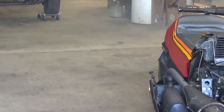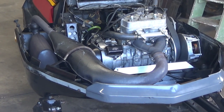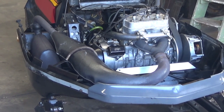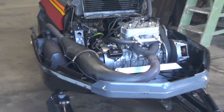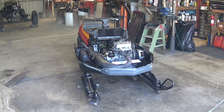As you can see, I fired it up. I did not let it run long — not more than a minute — so I've got to start it up and let her run for a little while and get her good and warm, seat the rings and stuff. But it runs. And before the rebuild, I always had to use some starting fluid or carburetor cleaner in one of the cylinders to get it to pop, and then it would pick up and go.